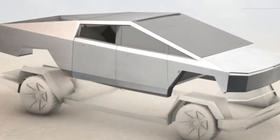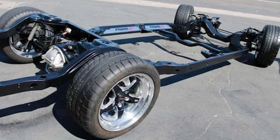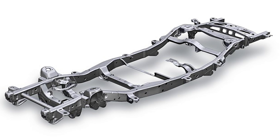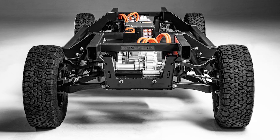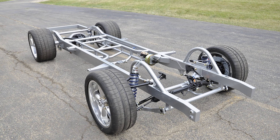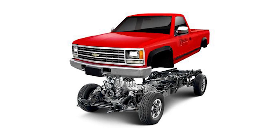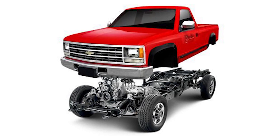Now we bring structural engineering into the fold. Your typical pickup truck is what they call a body-on-frame design. The frame is the structural heart of the truck — the body and the bed just sit on top and do not contribute to the structural integrity. The tensile strength of the pickup truck comes primarily from two boxed steel rails that run from the front to the back, tied together at a few points in between by lighter metals. So when you load the truck up with cargo, or tow something heavy, or go around a corner very fast, there is very little weight distribution — it's all concentrated on those two beams. That means the entire cab and bed of the truck are dead weight, and they actually just become more payload that the frame has to carry.